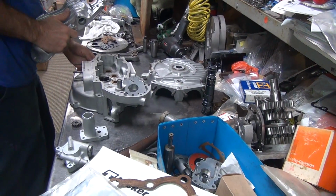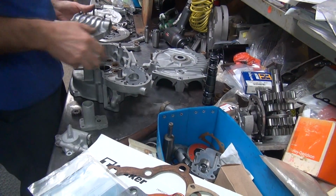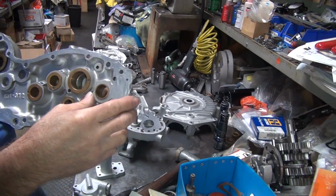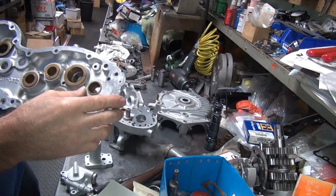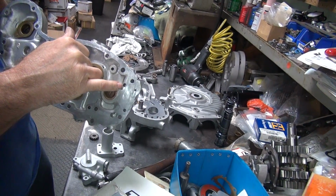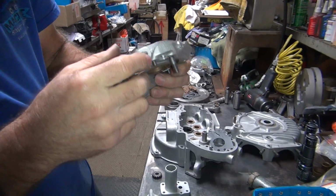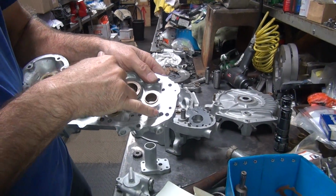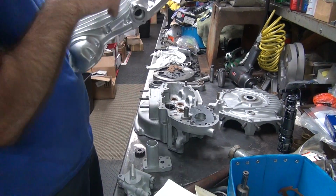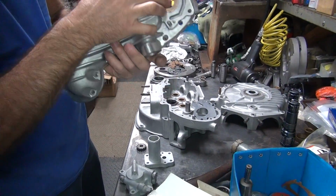Okay, this is a gallery that goes down. This is your breather gallery. Goes to here. It's this one. Why they got that opened up? That's weird. That's a drill gallery, but they're dumping oil. So this must be pressure relief here, I guess. Looks like it goes down to here, which is probably this. It goes over to here. It comes up to there. So that's your breather channel. So what's this hole going to?